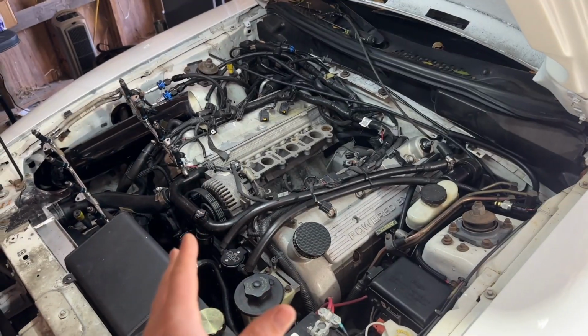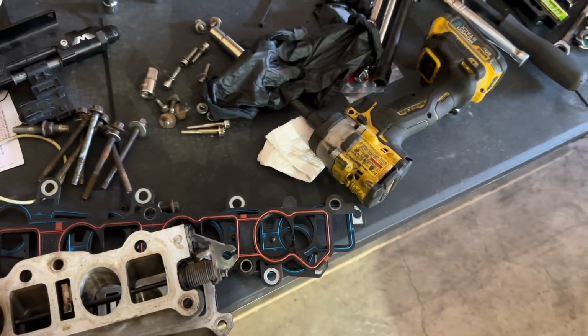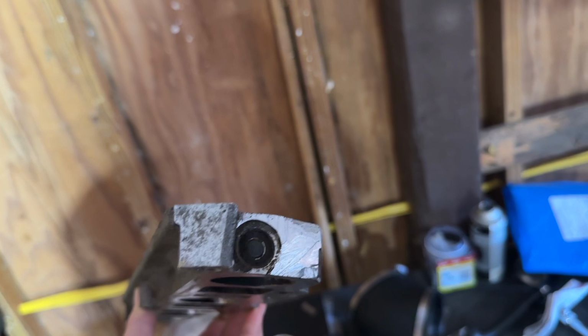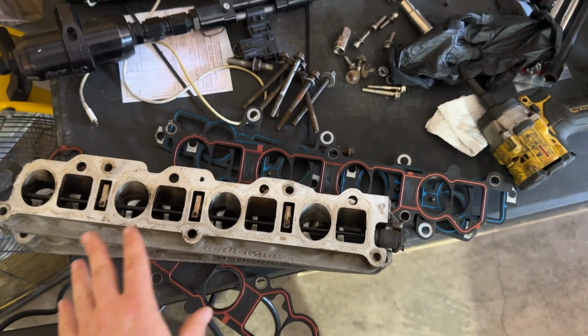All right, guys, so we got the blower and IMRC plates off. This one had the stock ones and the flaps were removed, but I read that there are some O-rings on all 4 corners right there. You can see that it looks like some carbon buildup right there. There's one there and on both of them. My theory is that that was leaking.